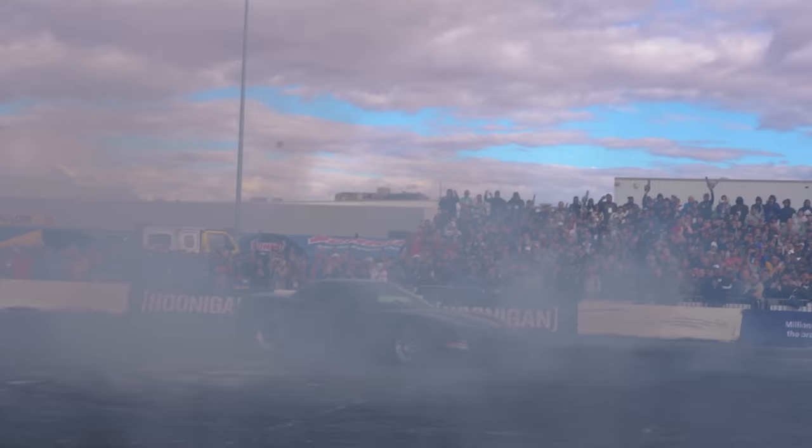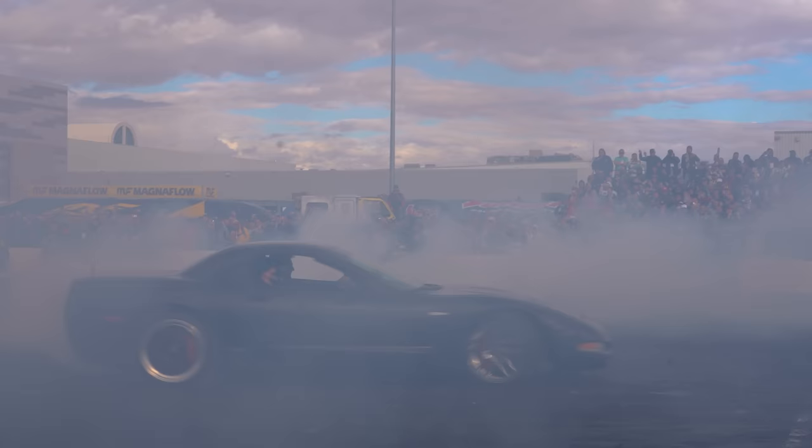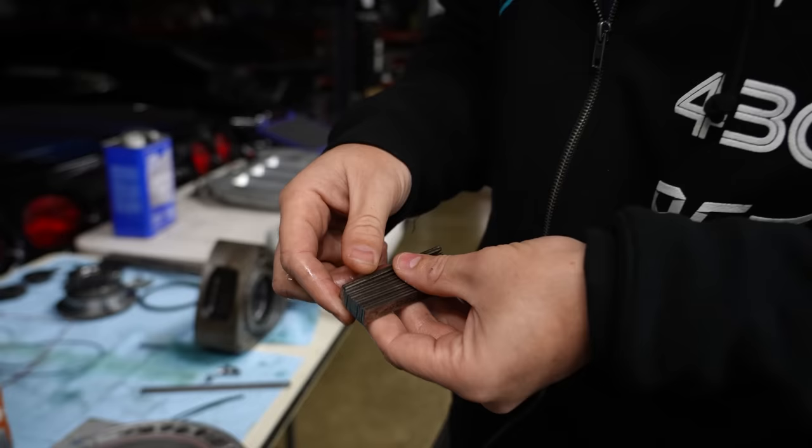We kept checking it. Not that we had a problem, but we were just seeing, is the dyno going to make it worse, and so on. It wasn't until we did the burnout at the burn yard in Vegas that we noticed compression went up to 120. How? So it's teaching me a lot that if you go with harder apex seals, there is a break-in period if you're expecting to get better compression.